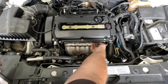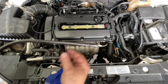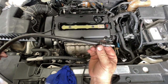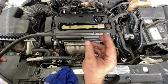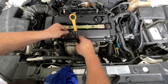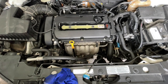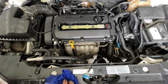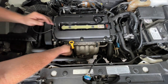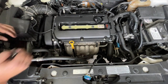I'm just going to line it up and get that first bolt in place. Now we need to put the dipstick tube in as well — normally it just has the one O-ring, but this one has an extra one. Those O-rings are still quite soft and haven't gone brittle, so I'm happy to reuse them. The tube needs to run down through that little gap and often you need to get in from under the car to line it all up. Sometimes if those O-rings are new you really have to press it in hard. There's a Torx bolt that secures the bracket for the dipstick tube — make sure it doesn't cross-thread, because there's often a little bit of pressure from the dipstick tube pressing up.